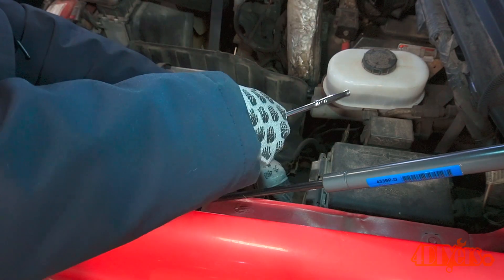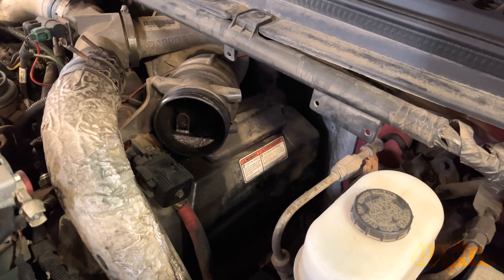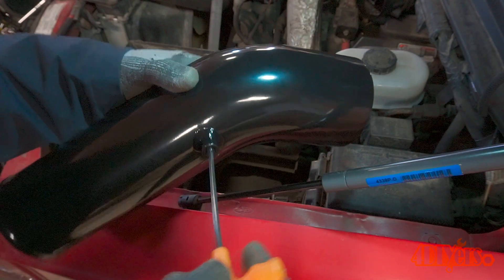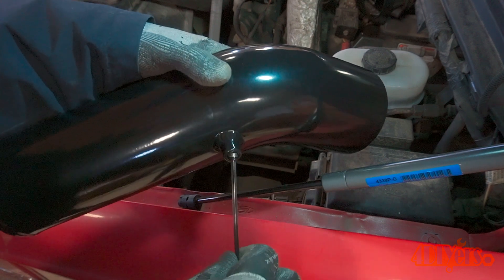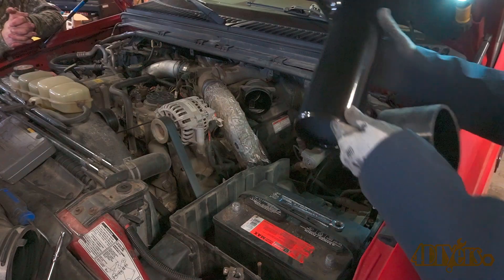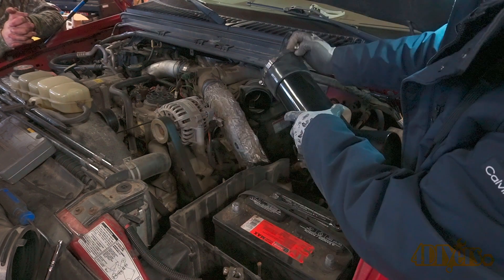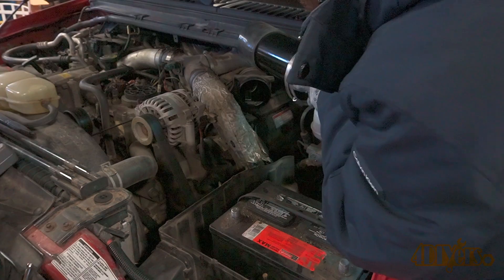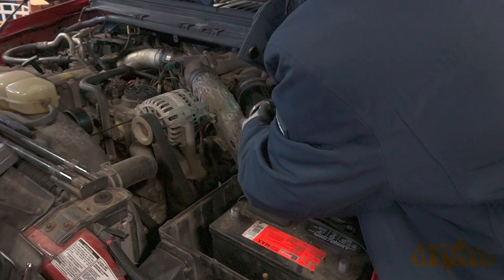Use the factory fastener to install the small bracket for the airbox sensor. Once installed, here's a quick view with the old airbox removed and the new bracket for the sensor installed. Using an allen wrench, remove the grub screw from the fastening point on the intake tube. Now install the intake tube to the bracket along with the supplied bolt — don't tighten it just yet. Install the silicone adapter onto the new intake tube, making sure it's about halfway on. Install the gear clamps, making sure the screws are easily accessible. Now install the silicone adapter onto the engine.